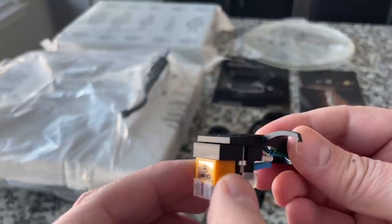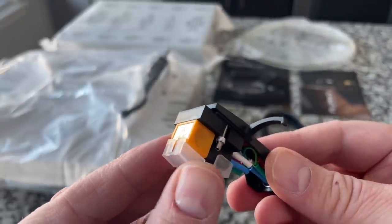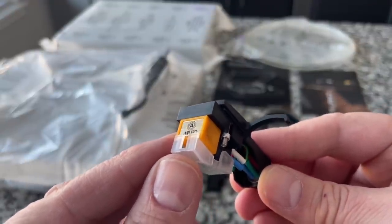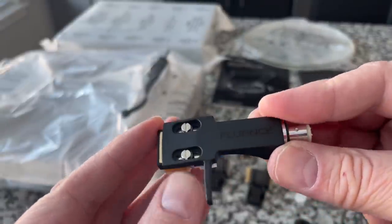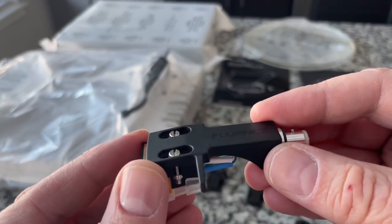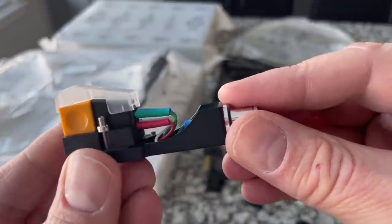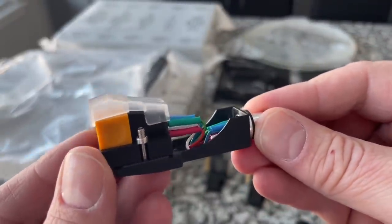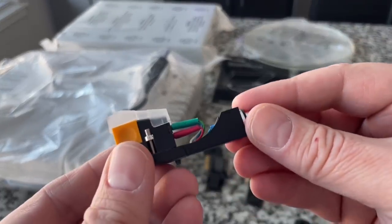This MP110 in the Nagaoka line is about a $149 cartridge if you were to buy it separately. The stylus — the yellow housing — has nice little finger indents on the side with a good feel. The stylus replacement is about $63. It is an elliptical — I believe 0.7 by 0.4 — a polished brushed diamond bonded to an aluminum cantilever, coming in a Fluance head shell with a standard half-inch mount. Everything is insulated with oxygen-free wire through the tone arm.